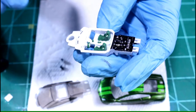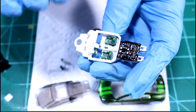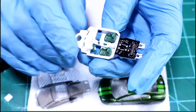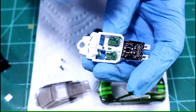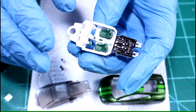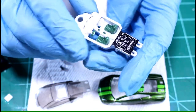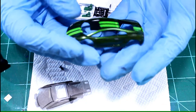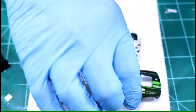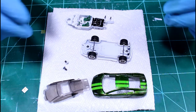On top of that I put five or six coats of Createx clear. Let me tell you - I was not a believer in water-based clear coat, but after using it and learning the secret: the deal with water-based clear is you have to put down a lot of layers. The problem is water-based clear is mostly water and not a lot of clear, so you really have to put layer upon layer to get that glossy coat. That's not a problem because water-based paints dry really fast. The body itself has about 10 to 12 coats of clear on it and came out pretty well. So it is done, and really all that's left is reassembly.